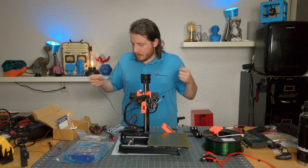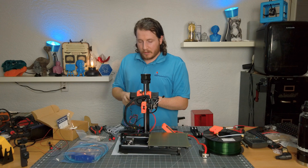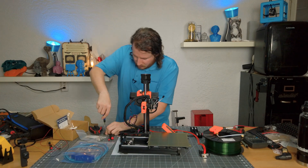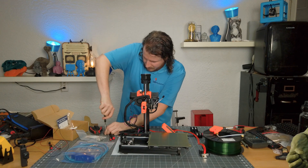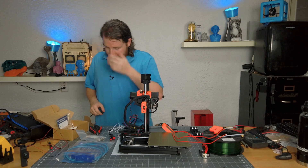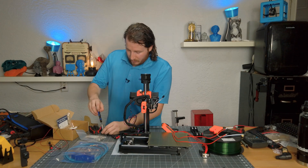For the heater wire we have to go back to our old heater and get that connector apart. You will need a flathead screwdriver. These things were torqued down by the Hulk — they're done at the Prusa factory, so you know it's quality. We have our new wires which already have ferrules on them. The nice thing about heaters is they are not polarized, so everything should just easily go right back together.